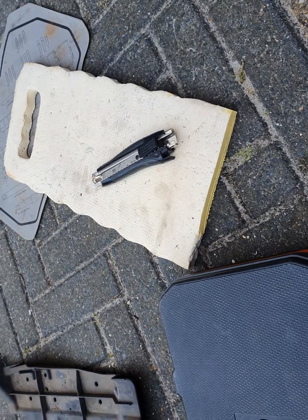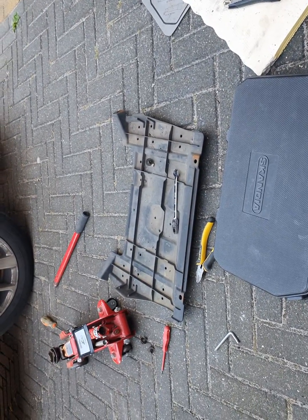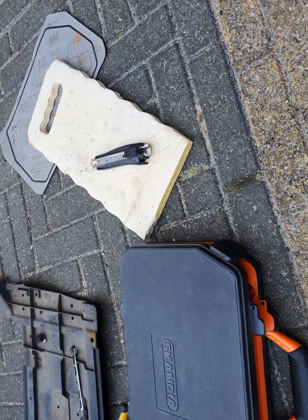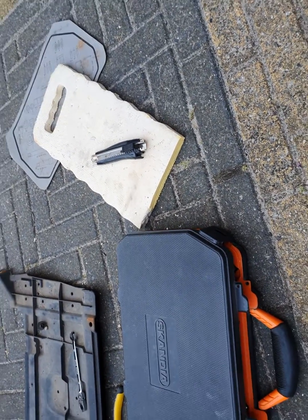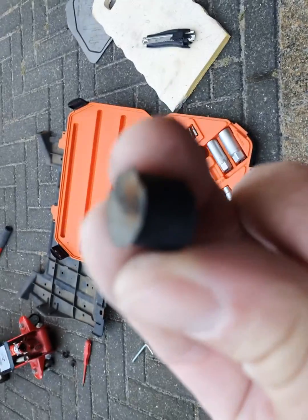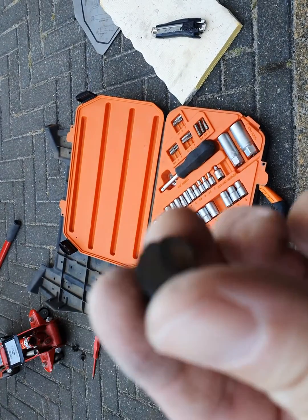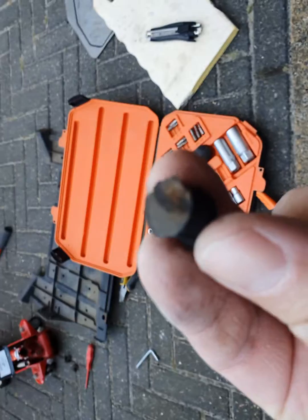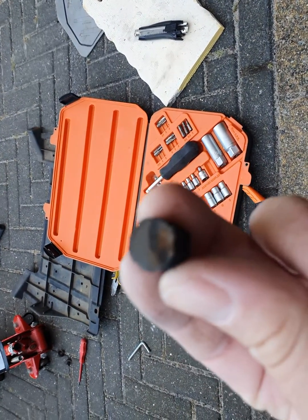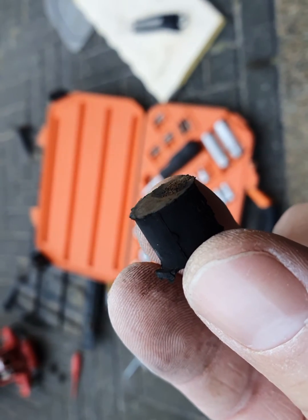So yes, I need new clips, because that one was attached with three out of four, so it was a bit of flapping in the breeze. And I need four of the new rubber grommets with the correct threaded end. It doesn't look to be huge, but based on this, which was luckily caught by the bottom plate, I should be able to look up what I need — it looks like something like M5-ish thread.